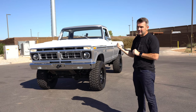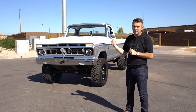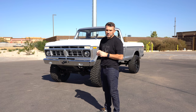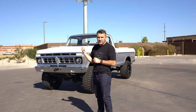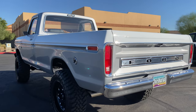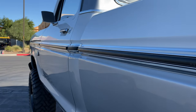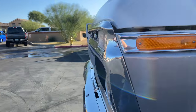The guy that owns this truck is going to have a ton of fun driving it. It's not tuned super powerful — we kept the pulley larger because you can already do a burnout in third gear and get sideways that fast. We also wanted to err on the side of safety. If he wants to change the pulley and get it up to 800 rear wheel horsepower, that's up to him.